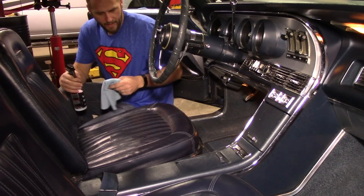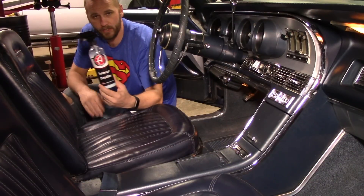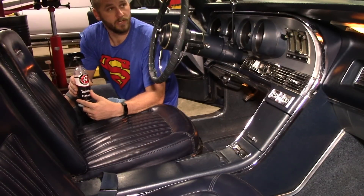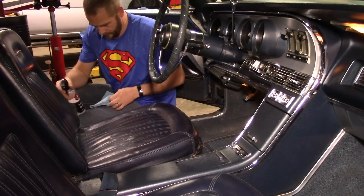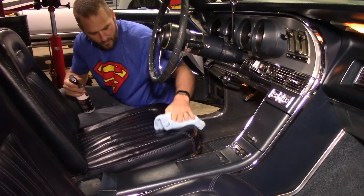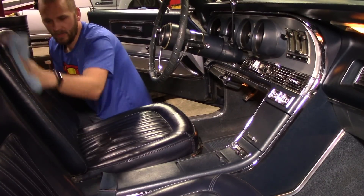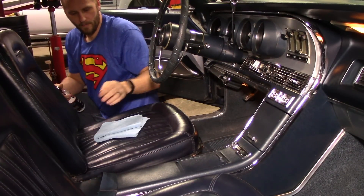This is the next day. I cleaned all this out yesterday, left the windows down overnight to let it all dry out. Now we need to put a protector on it — we're going to use Adam's interior detailer. I chose this to try to get rid of that vinegar smell, and it has a really good eucalyptus mint smell. We're just going to spray it directly onto everything, onto the seats, wipe it down — it's going to put a UV protectant on here and hopefully a barrier from future mold.